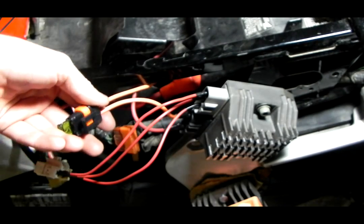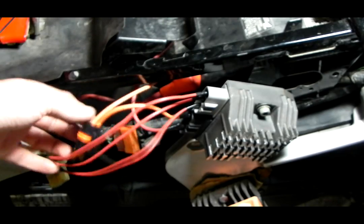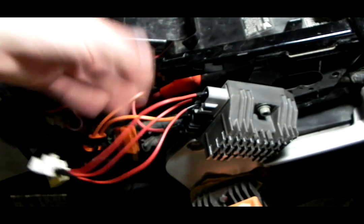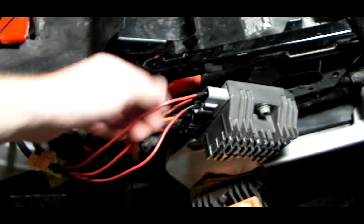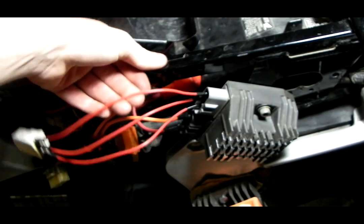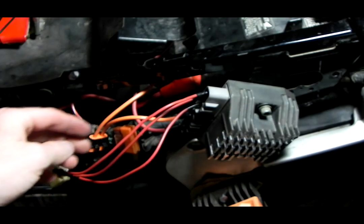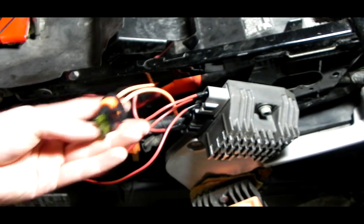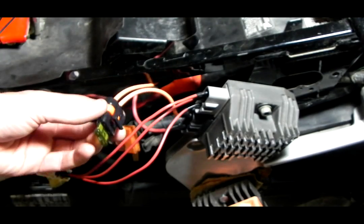The only reason I'm not going to use it is because it'll just constantly go on and off. It cycles on and off until the problem's fixed. Well, I'd rather the fuse blow and stop electricity flowing. You could have a short, and I've had this happen before, and power is still going and it melts something, and the sheathing around the wire will smoke a storm. I had a 16 gauge wire in my car, little bitty, and it filled up my car with smoke as I was driving. It grounded itself out. So this stuff is really bad about smoking. So I'd rather the fuse just blow and just buy a ton of these than have that breaker constantly going on and off, because it won't stay off. It'll just cycle on and off constantly until it's fixed.